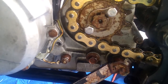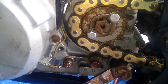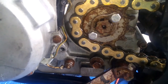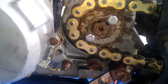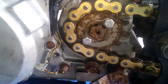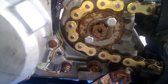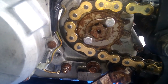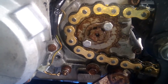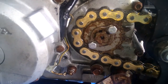On my bike the sump plug had been welded over as part of the damage repair. If you were to take your sump plug out, you may be able to fiddle around up there with a bladed screwdriver and just ease the spring end back onto the tab, because you have a fairly good hole there through the sump plug. But maybe it's not so simple, because the sump plug hole is not a totally round hole — it's like half a hole going towards the middle of the crankcase, and the outer part is part of the thread. So you may have no choice but to make a big gaping hole there and then put a plate over it when you're finished.